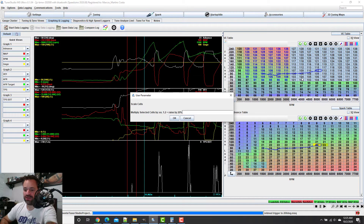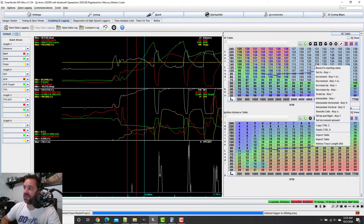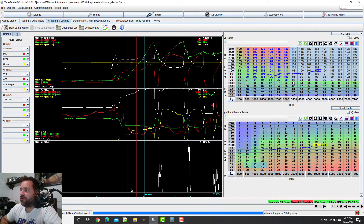I'll set it to 0.92 of the values. One tricky thing: copy everything with Ctrl+C first, because if you don't like the values you cannot revert. Now we've got it — the only thing is here the value is richer and lower than the next cell, so I might need to mark those values and interpolate again to get a nice smooth ramp.